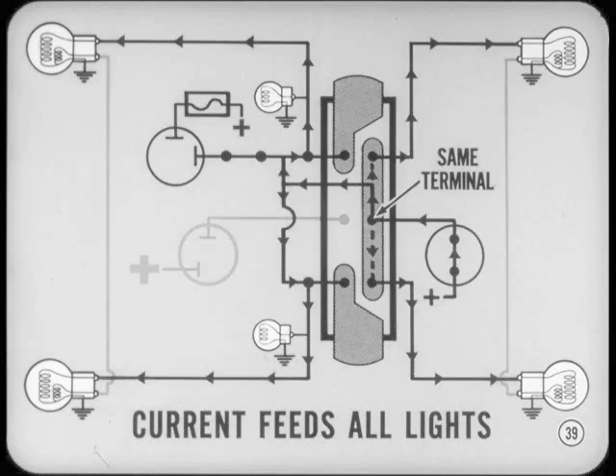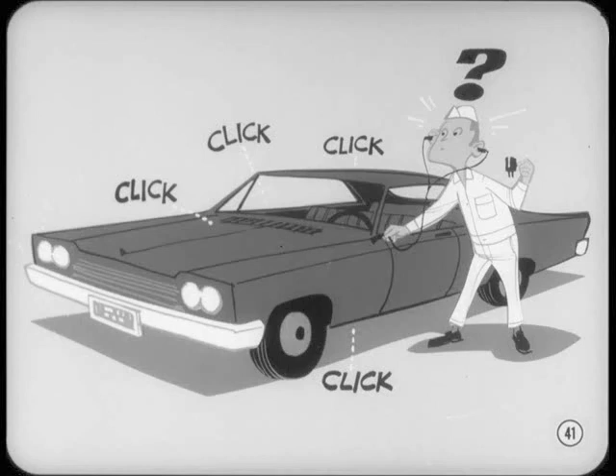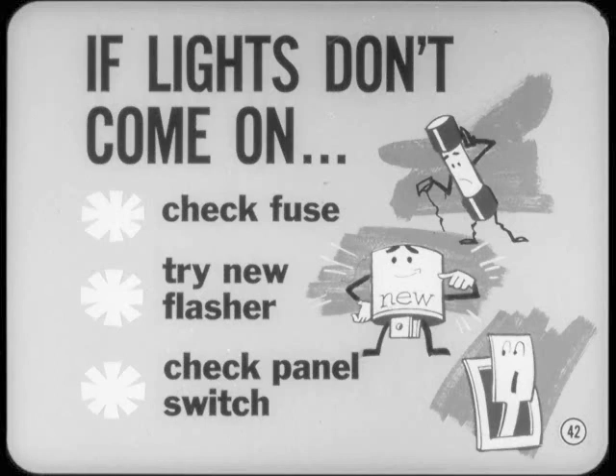The hazard warning circuit for the rear lights connects to the same turn signal switch terminal as the stoplight switch, so the current from the stoplight switch also goes through the hazard warning switch, feeding all the front lights and the indicator bulbs too. Of course, there's also the possibility that the steady light condition is a result of the contacts in the flasher unit becoming welded together. That's easy enough — I'll just turn on the switch and listen for the flasher. If I can hear it, then the trouble has to be in the stoplight switch. That's good reasoning, Danny, but you can't always hear the hazard light flasher — it's located in different spots on different cars. So track it down and check it out with a new flasher, and be sure to get the correct flasher. If the lights don't come on at all when the hazard switch is closed, first check the fuse; if the fuse is okay, try a new flasher unit; if the lights still don't come on, check out the instrument panel switch.